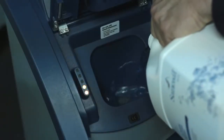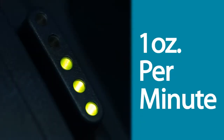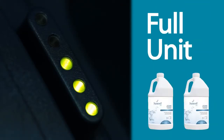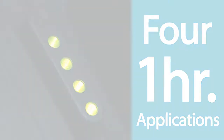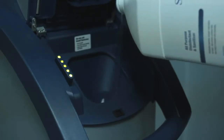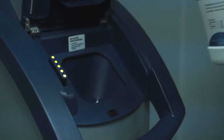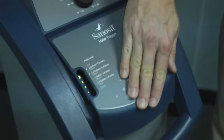The fluid level indicator lights will illuminate to show how much disinfectant is in the unit. In operation, the Halo dispenses approximately one ounce of Sanosil per minute and holds up to two gallons of disinfectant when full — enough for four one-hour applications. Stop pouring when the top green light on the fluid indicator is illuminated. Do not overfill. Wipe up any spills and close the reservoir door, ensuring it clicks shut.